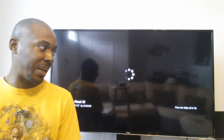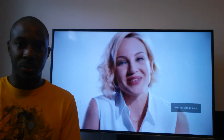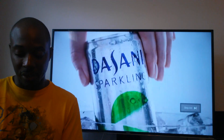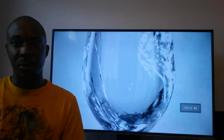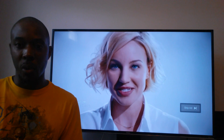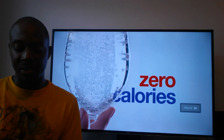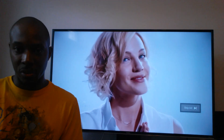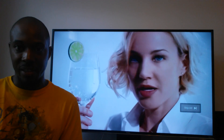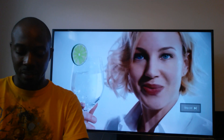The backlight I have at 80. Brightness is set at 50. I don't really want to turn the brightness up because you really won't get those tones, the right skin tones for people. Contrast is set at 80. My sharpness is down at 0 — they always tell you to keep it at 0. But once you turn it to the enhanced 4K mode, it's going to preset it at 27, so I just turned it back down to 0. I may kick it back to 27; I have to really take a look at it with a couple movies and things like that.